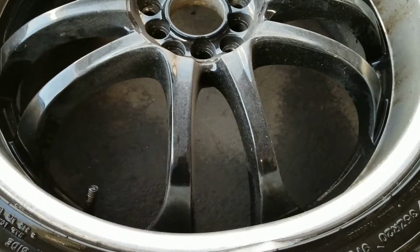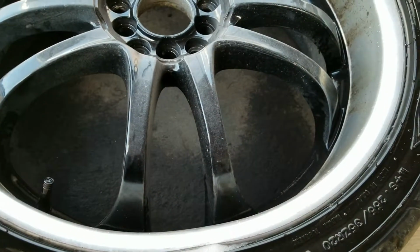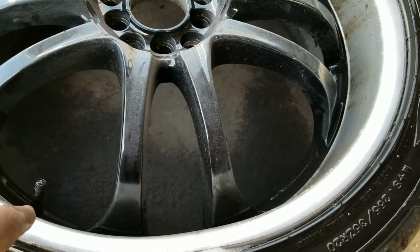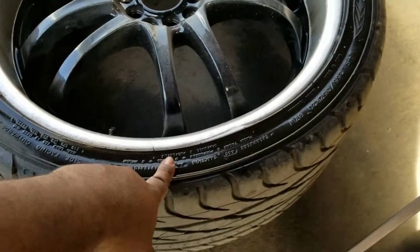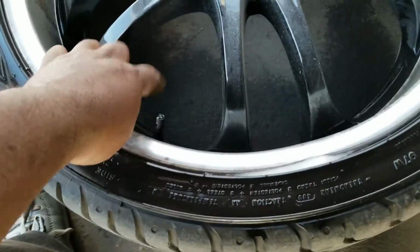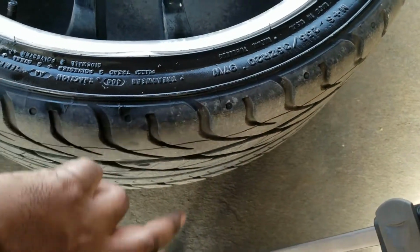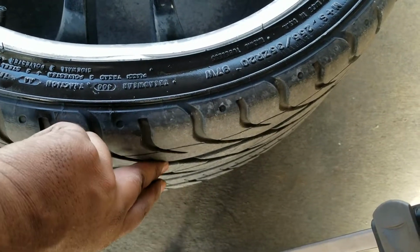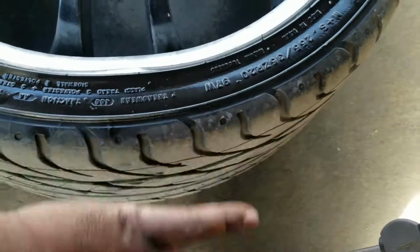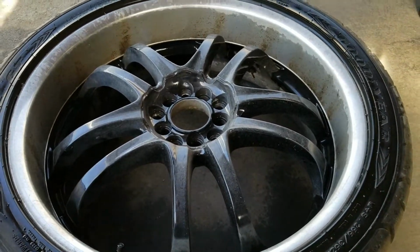I'll just recap in case you're wondering. There are other ways and lots of other things you can do to fix it. If it's a rim, pretty much done. Sometimes they can be sealed up or welded, cleaned up from the inside, and sealed from the inside. That's always iffy. Sidewalls and the side of the tread cannot be fixed. If that's damaged, might as well get rid of the tire. Valve, you just need a new valve if the valve is the issue. And if it's up here on the tread, then it could be something where you can get a puncture kit, or you may have to replace the tire depending on how bad it is and how the hole is and everything. So these are all things you'd have to weigh out. But ultimately that's what it is, and that's how you test your tire.